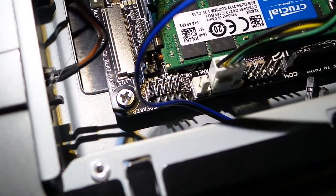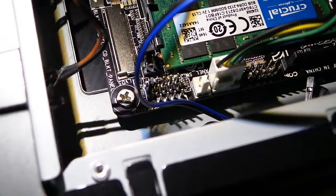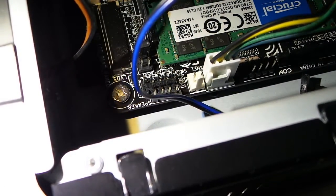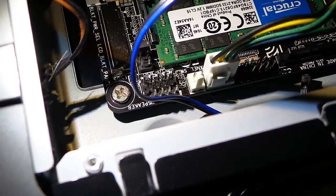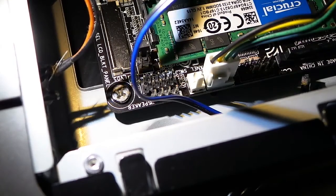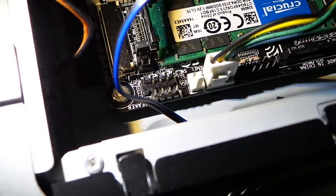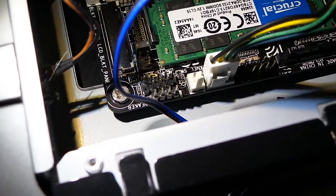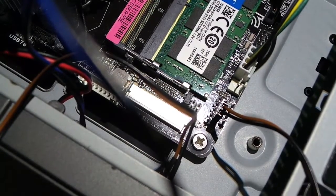I'm using my phone to provide a bit of light. I've screwed all four screws into place, and now I need to connect the chassis header to the motherboard. This particular motherboard didn't offer a very clear explanation, so I had to use the trial-and-error method. I suggest connecting the power switch cable first — that's the cable that allows your computer to boot up — and then the other headers. I found the correct position and can now close the case.